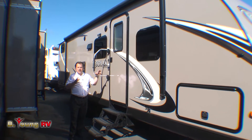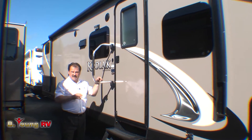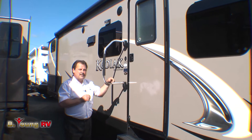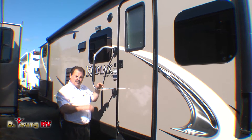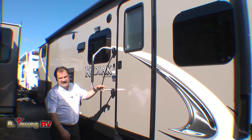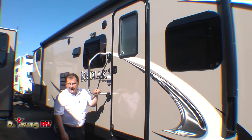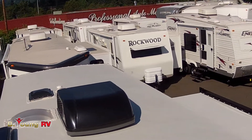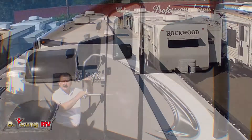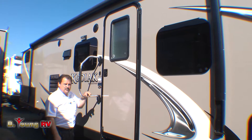One of those reasons is the six-sided welded aluminum frame. So many coaches in the ultralight category are made with aluminum frames, but when it comes to the ceiling they stop and put wood trusses in for cost reasons and because it's easier to get into a tapered position. They go the extra mile with the Kodiak — they build a welded aluminum frame truss over the top, five inches thick at the center tapering down to two inches at the side. It is one of the better built ones.